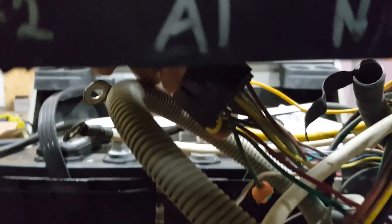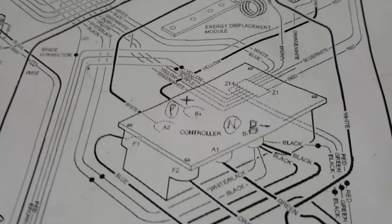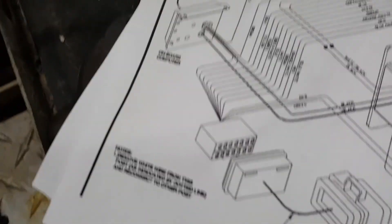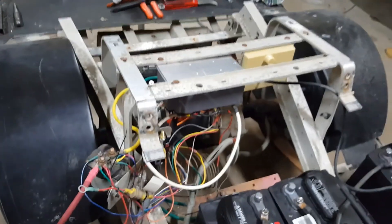Some of the wires go all the way down, so this is the beginning of it. What I noticed is the plug on this cart — on the original diagram — has 13 wires going into it. That's the plug labeled Z14 and Z1. There are 13 wires in that one, but the plug for the harness only uses 12. There's an extra red wire. I believe when they bypassed it and put the two white wires on the same post and got rid of the green wires in that coil, it had something to do with it. Tomorrow I'll button her all up and take her outside.